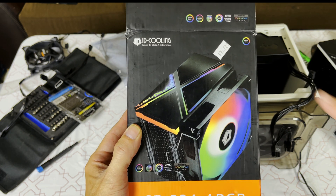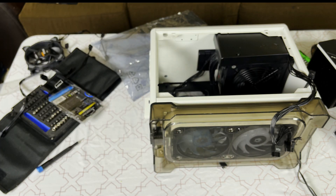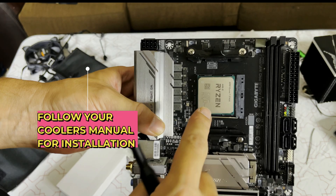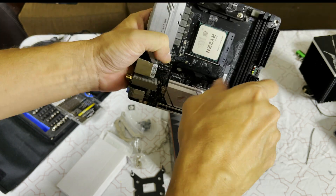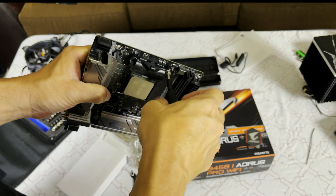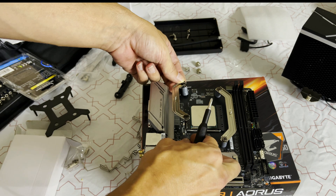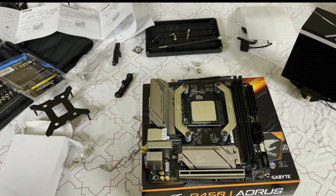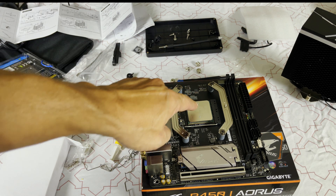It uses all these mounting parts — don't pay attention to the price, I have a pretty cool place I buy things at. They're just missing parts at times and I have so many extra parts. What you do now is get ready to install your cooling solution. First thing — remove these screws. Be aware your back plate may fall right off. Put these things in the motherboard box so you know where they're at. Now you want to apply your thermal compound to your CPU. Some coolers come with thermal compound, or you may have purchased it separately. We're going to clean the CPU off first because we touched it a lot.